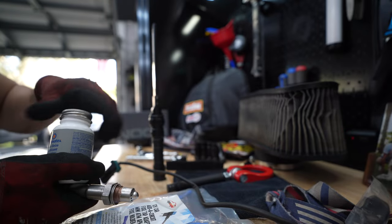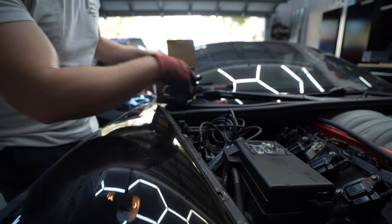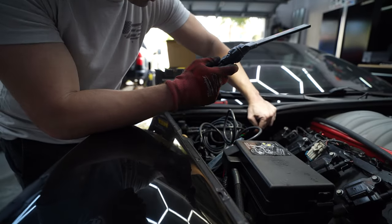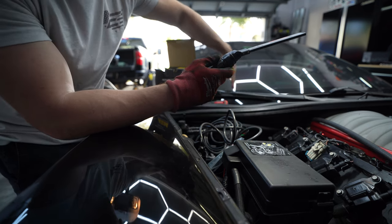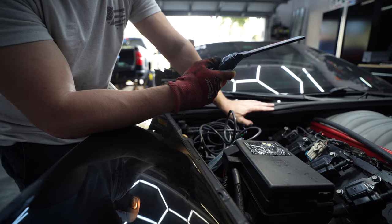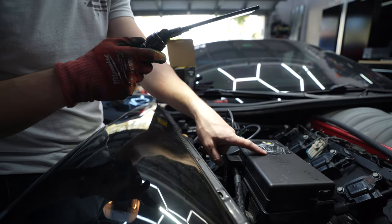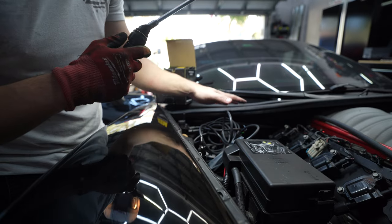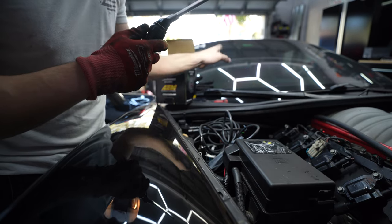I'm going to add some anti-seize because that original sensor was a pain to take off, just to prevent it from seizing on there. Now, down here on the passenger side of the car is the grommet and the wires that are entering the vehicle into the dash — it's right behind the glove box. I'm going with this route instead of going through the transmission tunnel, mainly because when I give it power I'm going to be using the fuse box here, then route it the same direction and fish them both over to the driver's side to keep the wiring consistent. I just tested pushing it through the slot and it cleared without an issue.